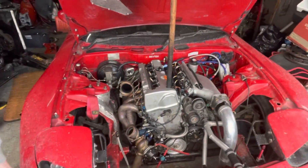As you can see, turbo is off. Some of you might have seen on Instagram, I fitted a Pulsar G30-770 on the car. That turbo spooled fucking rapid. It was a very, very fast spooling turbo, and it was quite a lot of torque, and I actually ended up snapping the prop shaft of the RX-7. A lot of torque load down on this thing. What actually happened was, I'd done a launch in it, it was quite a hard launch, and the back end dug down and snapped the prop shaft. With the larger turbos, obviously it's further up in the rev range, once I've got some more load on it, that I actually got the torque. Bearing that in mind, for me, using the car on the road and the Crail Raceway I use, which is quite bad traction, I'm hoping that the larger turbo with the lag will actually help me be able to launch and get out of the hole without wheelspin.